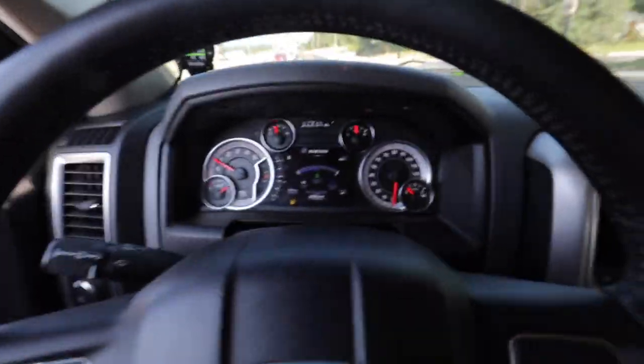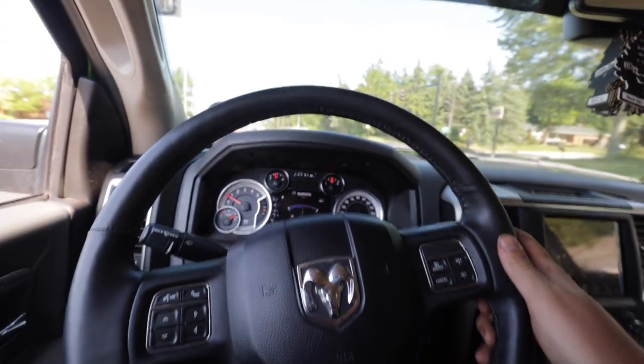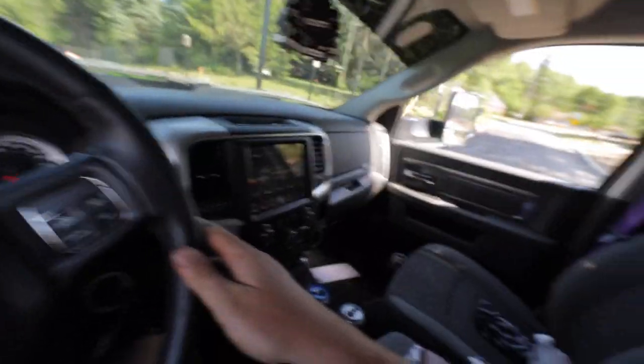This trip's been going good so far. We just had a low coolant light come on earlier when Katie and I were coming back from the scrapyard — there was coolant all over my passenger side running board. It looked like it came out of the overflow tube. The light just came on so I'm going to monitor that and see what's going on. The iDash coolant temp is still normal, so it's not super hot or super low. I think maybe the sensor just looked faulty for a minute, but we'll keep our eye on that.